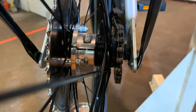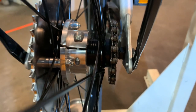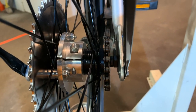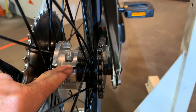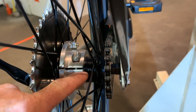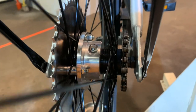Don't waste your time wrapping rubber around there, or a piece of metal, brass, or copper. These are Chinese parts - most of everything on these bikes are Chinese parts. Sometimes you've got to do a little extra work to make your Chinese part work 100% correctly. In this case I did not have to, but in some cases you do have to grind the flat spots where the two halves go together. Now I have this super tight, with a gap in between, and it is really gripping the drum. I've used these forever and a couple I've had to grind, but most I don't - they've worked perfectly and flawlessly every time.